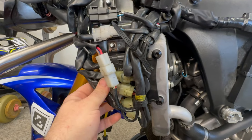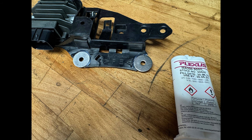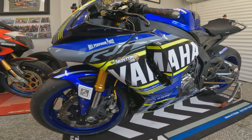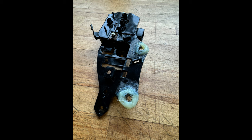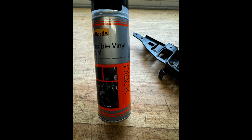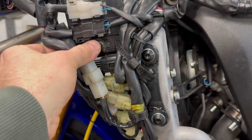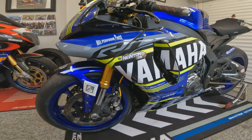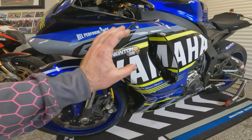So we removed the bracket and used this product called Plexus, which is basically a liquid plastic — a bit like an Araldite but far better, harder wearing, less brittle. We built the bracket out of a couple of washers. This will bond any material to any material with very minimal surface preparation. You do have to use it in a well-ventilated area, so be careful. Once the washers are bonded on there, we built the Plexus up, let it go off, sanded it back down to the flats, quick coat of vinyl plastic paint — bob's your uncle. The bracket's back on, fully securing the wiring harness. I didn't want to reinforce it with one solid piece of metal between the two holes, as if it did fail again it would pull the threads out of the radiator. So this way it still leaves a little bit of a weak spot — it's obviously a bit of a design flaw with the weight of the reg-rec up on top with the wiring.